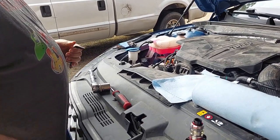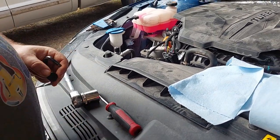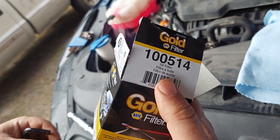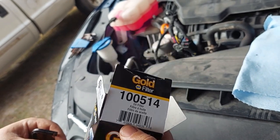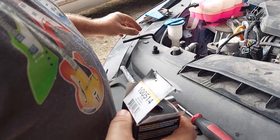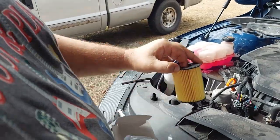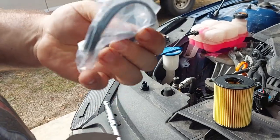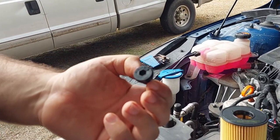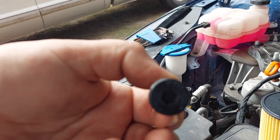For this car, you have a filter basket that comes off — it's similar to a Toyota. This is the only aftermarket filter I found for this vehicle because it's so new. If you can't find the NAPA Gold 100-514, call up your Kia dealer and they'll give it to you. NAPA Gold is also essentially Wix. It's not just the cartridge filter — you get a shiny new cartridge filter, a new gasket, and a new crush washer for your drain plug. You also get a new plug for the oil filter basket, which lets you drain the filter basket before you actually take the filter basket off.